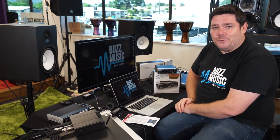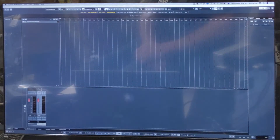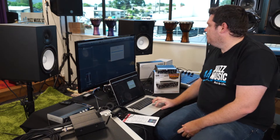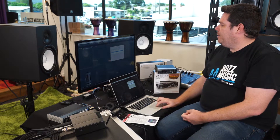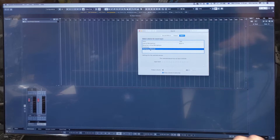Next thing we're going to do is actually check that the computer recognises the device. I'm going to open my sound preferences, and I can see here that my output is set to the Steinberg UR22 Mark II. If for whatever reason your device doesn't automatically recognise, you will have to head to the manufacturer's website and download drivers for it. I can also select my input to receive from the Steinberg UR22 Mark II. This now means that the operating system is going to route all ins and outs through your audio interface — so things like your web browser, Spotify, Netflix — they will all play through your device and whatever is connected to it via headphones or the speaker outputs at the back.